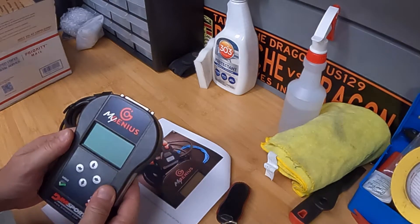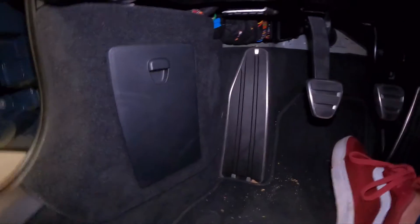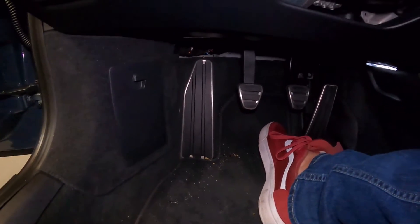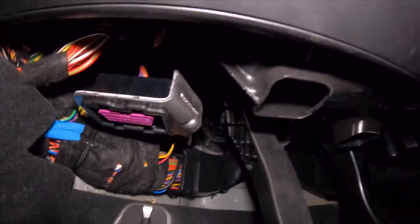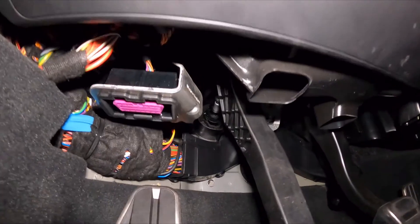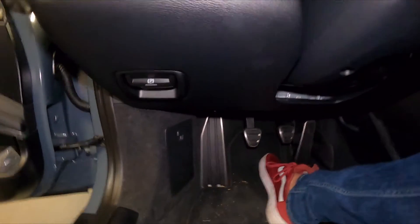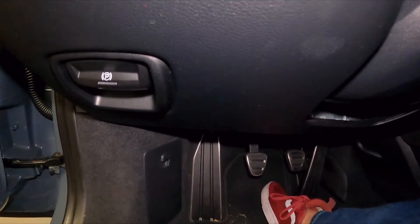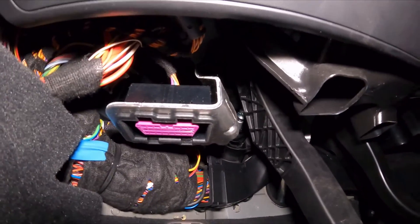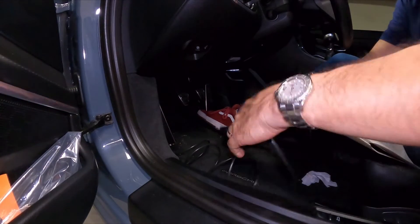This is just to show you where the OBD2 port is located in the Porsche 991.2. It is not located in the fuse box as you would think if you were looking it up on the 991.1 — it's actually that pinkish-purple connector. Just for perspective, it is underneath the dash pointing straight down, just to the right of the parking brake activator.